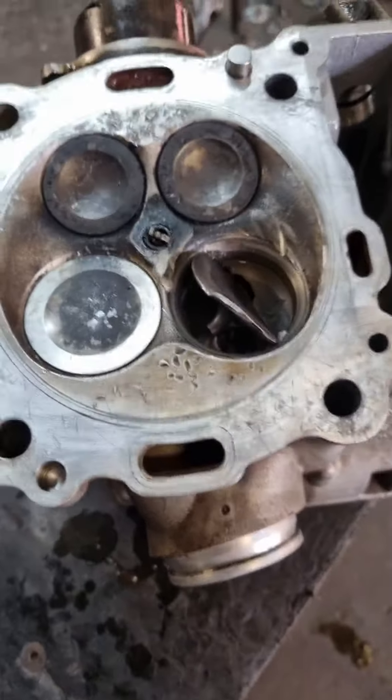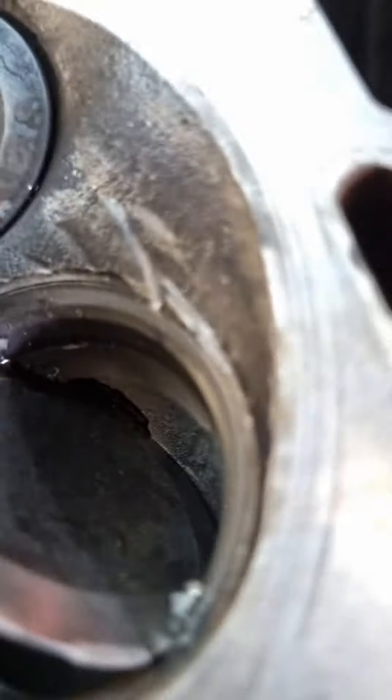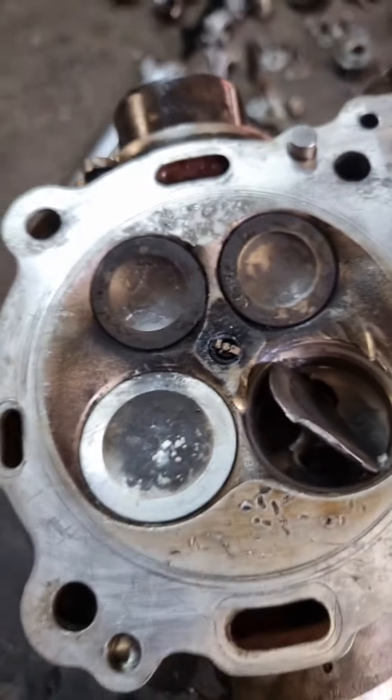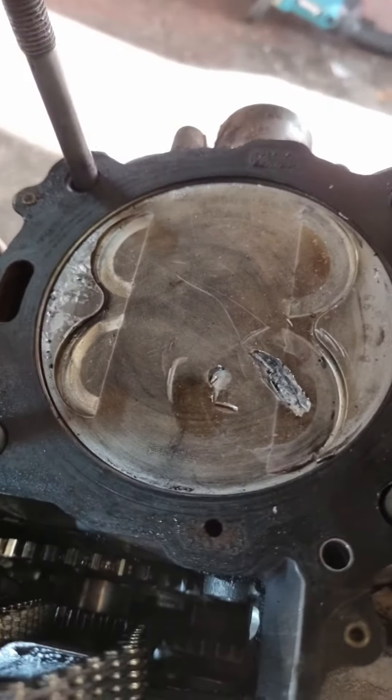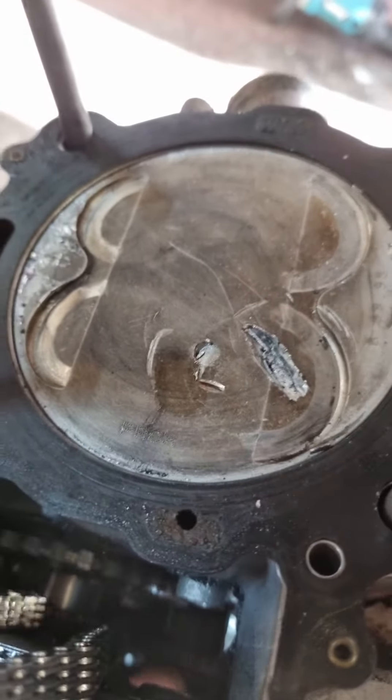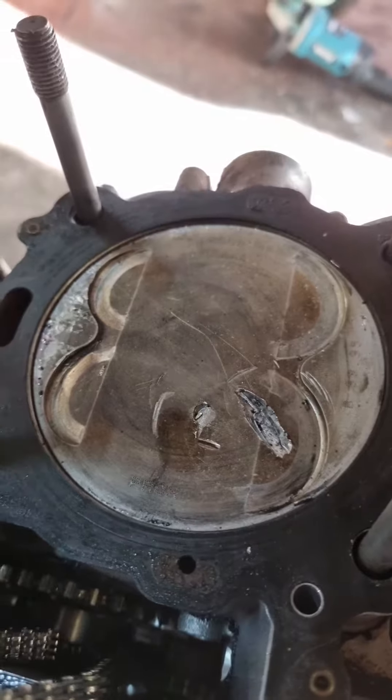Update on the KTM 505 - the valve snapped off. Right around the back it's actually smashed the valve through the head into the cooling jacket. It is a pile of bits, and look at that piston - it's ooshed. I don't know if you can see it.